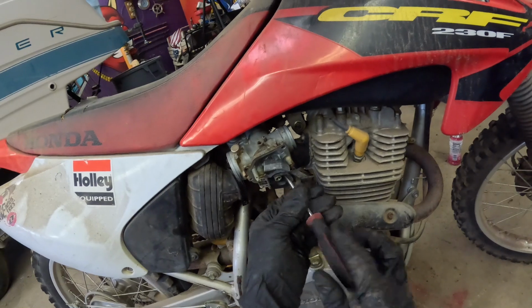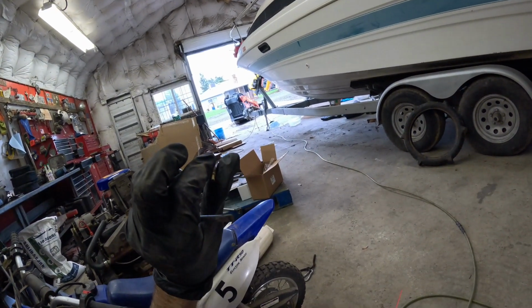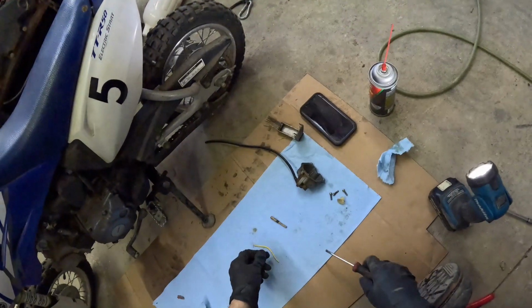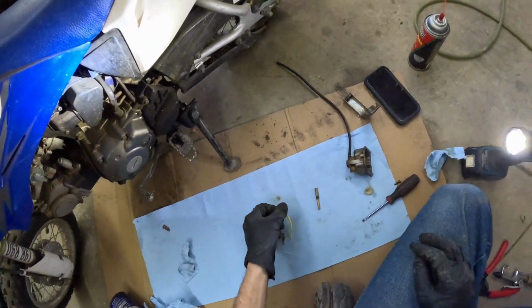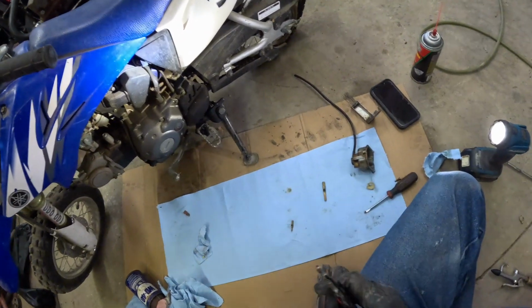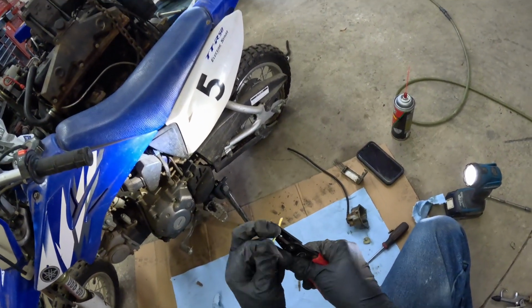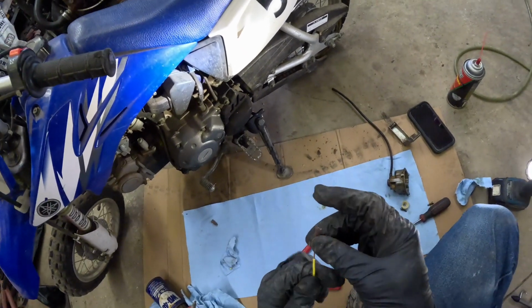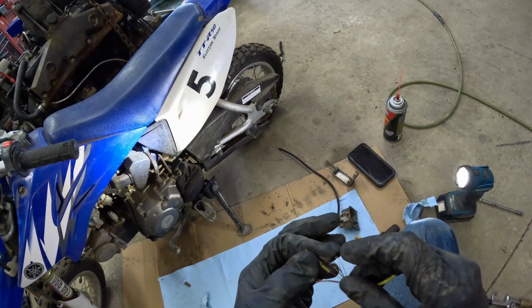You know what we didn't do? We didn't look to inspect completely through that one. This one, I definitely want to re-clear it. So let's re-clear this one, because I cannot see all the way through it, and this one is very long. So we're going to need a longer piece here of wire. There we go. Let's just take off a couple strands here. And we're going to run it through.